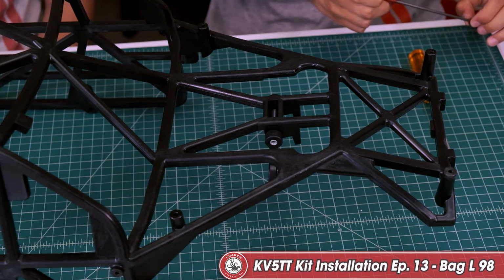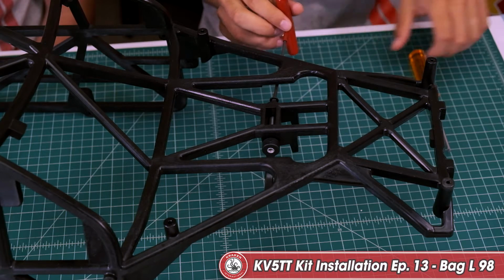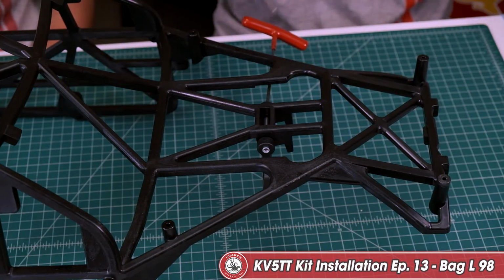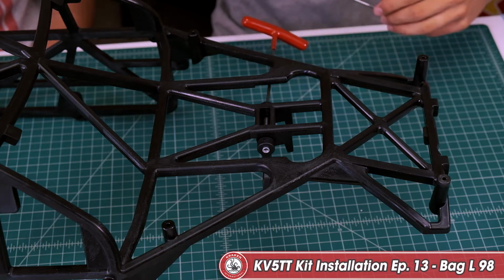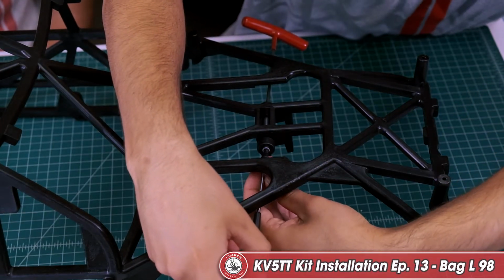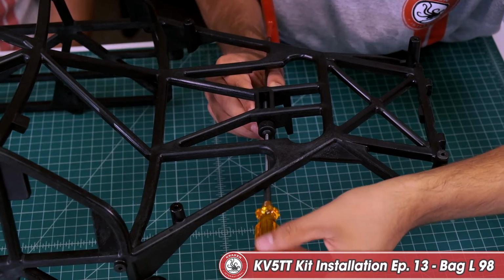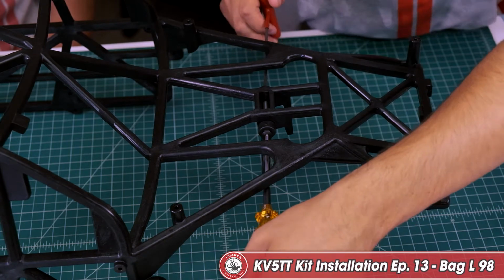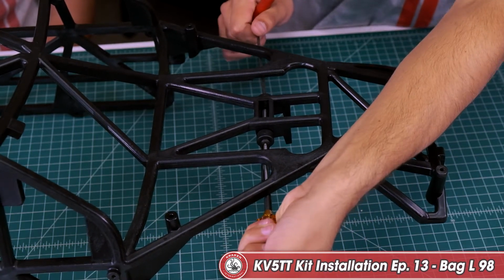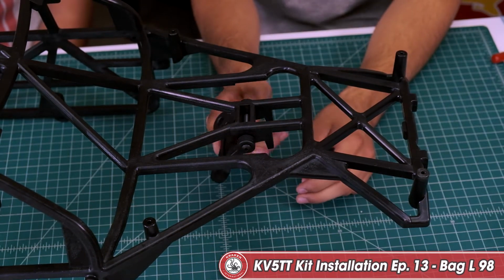Okay, so here don't forget to prime and blue thread lock the screw before installing. And we're keeping this T-wrench in as we go in through the other side because we want to get the right amount of torque and make sure that it's just not spinning. And once it gets tight and starts spinning the other T-wrench, we're going to go ahead and apply the same amount of force on both ends, and that's good. So we got the roll cage sorted.